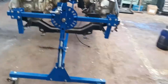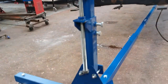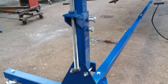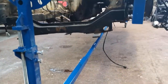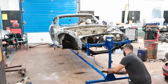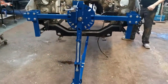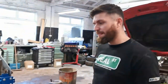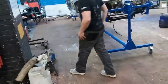It's not quite high enough. This jig's got three settings for the bolt holes — we're on the middle one. It's also got a thread you can wind up and down, so we've probably got about 10 inches of travel there. We'll wind that up two thirds of the way and try spinning it over again to see if we clear that bar. Second time lucky — we've wound it up about four inches.